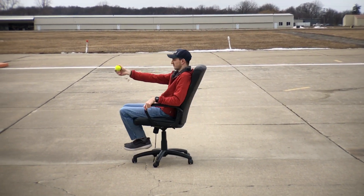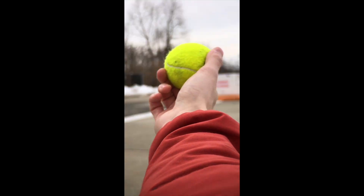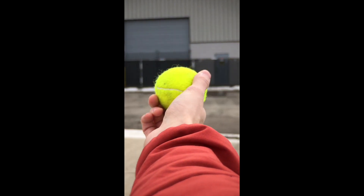The answer is that the blades are feeling the combined effect of two forces: lift and also centrifugal force. Centrifugal force is not an actual force — it's just the inertia of the main rotor blades pulling them outward. This is similar to if you were holding a ball and spinning in a chair. You have to hold on to the ball with your hand; if you let go, it just shoots out tangentially. The rotor blades would do the same, but they're bolted to the rotor mast, which holds them in.